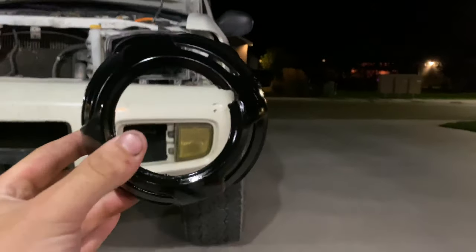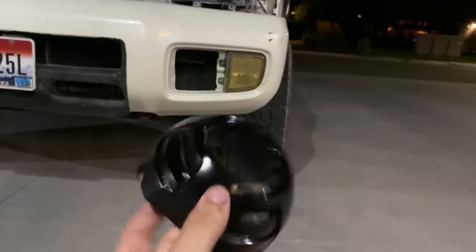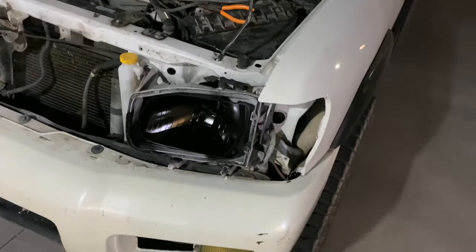With the flat sides on the bottom and the top, to line up my R50 I use the pointy one on the bottom, and there are two flatter ones that fit on the three notches. What I noticed is that the lower edge rubs against the housing ever so slightly, feeling like it's going to pop off. You can see the paint scrubs from that. So I took a file to it and just beveled the corners a little bit — now it fits on perfectly.